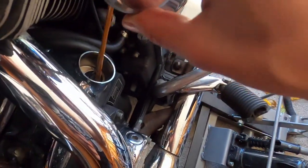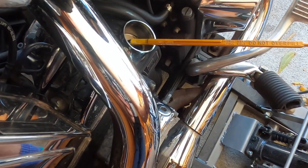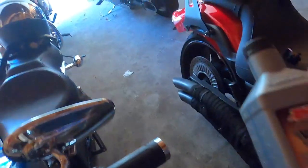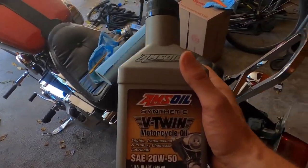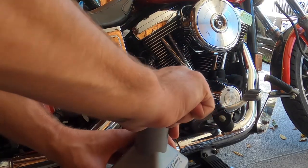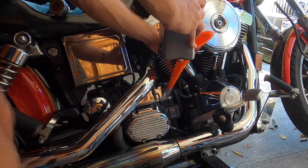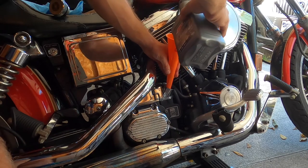Yes, this is day three of a three-hole oil change - because three holes, three days. Let's shove this bad girl in here, pull her out. Let's see where we're at - right below the full cold line, so we'll add some more. FYI, some Amsoil synthetic 20W50, and I'm putting this also in the primary - I already did that as you saw. So that's what we're running. Full quart and we're about a little less than halfway, so we'll put about a good 12 ounces in there and then fire it up.